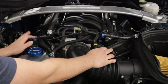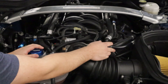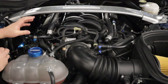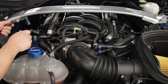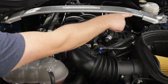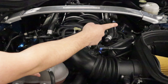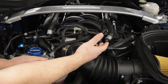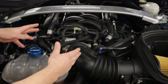This is what it'll look like from the factory, most likely. If you have the optional Ford Performance AOS kit, it will be installed essentially the same way — you'll just have this in line with the two tubes. It'll be connected basically like this, and this will be over there on the shock tower. They're held on by some plastic clips and one 10mm nut on the airbox on the driver's side. So we want to go ahead and remove all of this stuff and then we can get to installing our AOS.